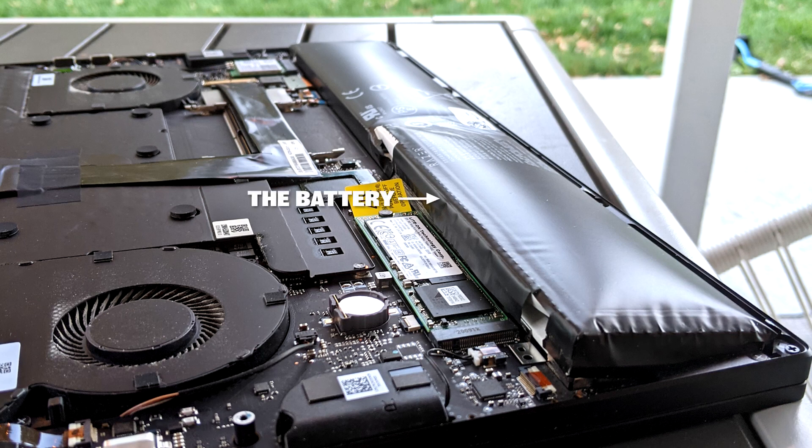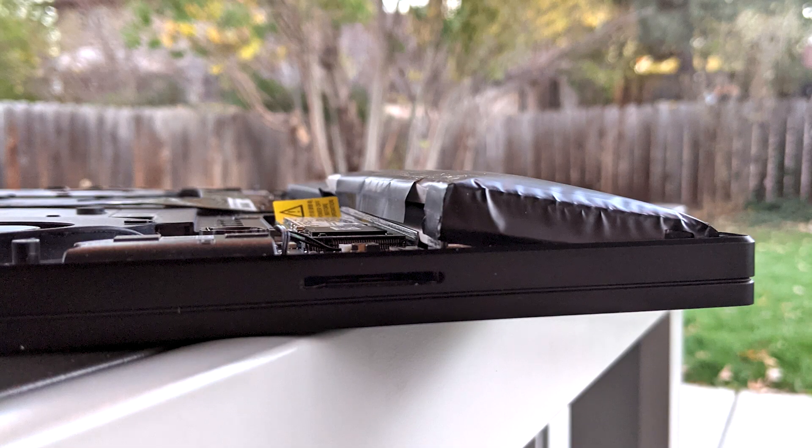What I did not anticipate and what I didn't even know to consider is that the batteries inside these machines cannot handle the extreme heat that comes from constant GPU rendering and heavy workloads over long extended periods of time. My problem was that I would always have it on my desk on a stand, so I never even considered that the battery might be swelling because I hardly ever closed the lid. But that's exactly how I found out it was happening. One day I took it off and tried to close it to pack it away and it would not close because the battery was swelling inside — it was bulging up on the trackpad and the keyboard. I quickly ran it outside, took off the bottom compartment, and the battery just popped up like you saw in the picture.